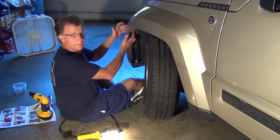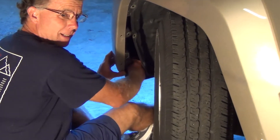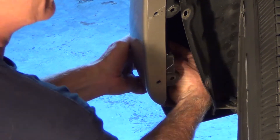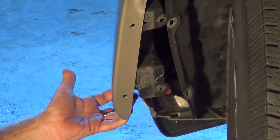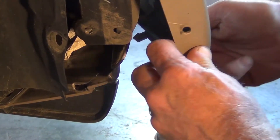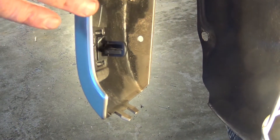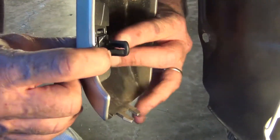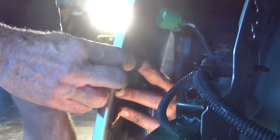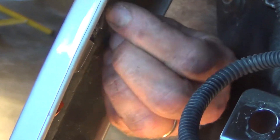The next step is to remove three of the clips holding the fender flare onto the bumper cover. Down at the bottom, you've got to play with it — it's locked in. There are two tabs, and right above that is the first push pin. It pulls right out. These are the two clips on the bottom; they don't pull out together. You really have to manipulate the fender flare to pull them out while squeezing the fastener. The two edges squeeze together and it pops right out — that one's easy. The other one is difficult. I actually pushed into one side and finagled it out. The clip is still fine, still works fine.